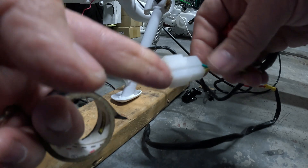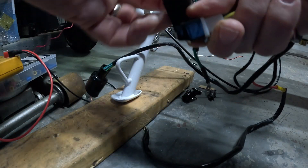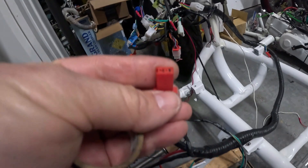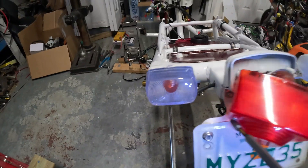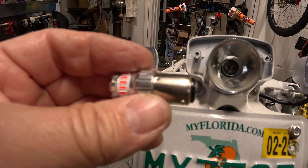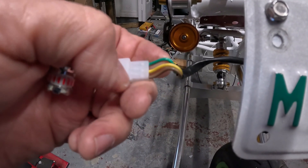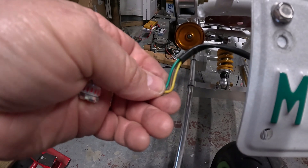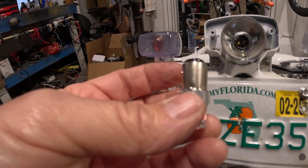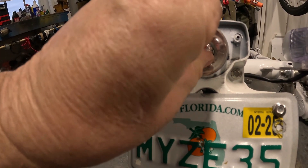If you have something like this wire that went to the stator — it's got pretty big prongs on it — I can see that bouncing around and hitting metal. I'm going to go ahead and tape those up just to insulate them from accidentally hitting something metal. You can see it's a combo tail light and brake light. I've got an LED one here that I replaced it with to make it a little bit brighter. When you look at the wiring, the running light is coming in on AC and the brake light is coming in on the green one, which is DC. Now these will both be DC power.